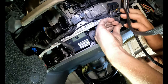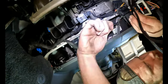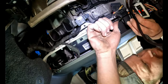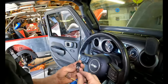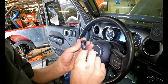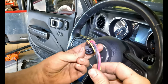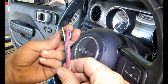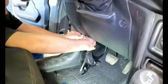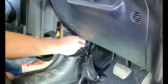Ryan fed the wire through the bracket. Black on the bottom right, red on the top right, and yellow on the top left. And if you look at the back of the switch, you'll notice the terminals are towards the top, and there's a bigger gap on the bottom, so that's our reference. Okay. Steps. I can just pop the switch in. Okay. If it's easy to pop out, I would just leave the wiring in for now, in case you have to pull it out. Not zip tie it up.